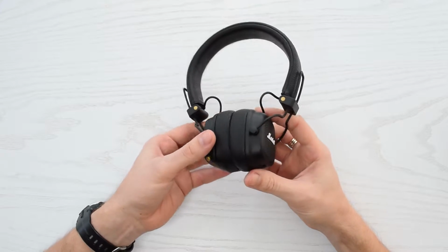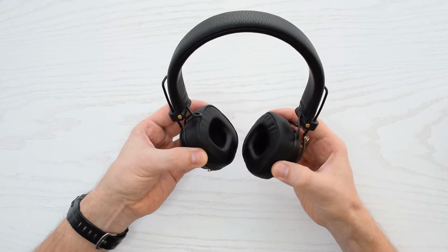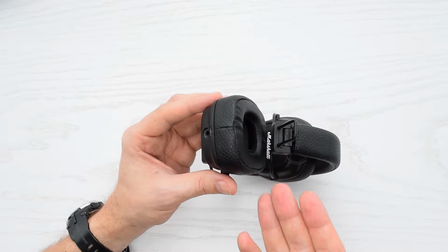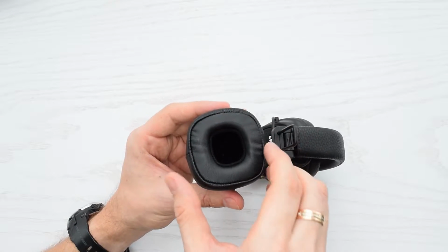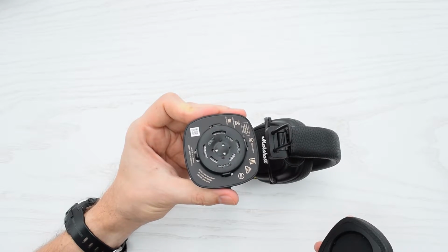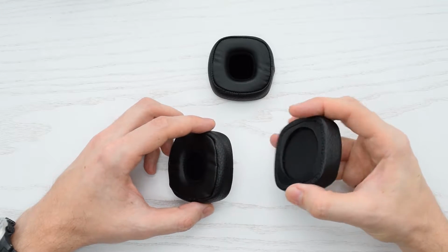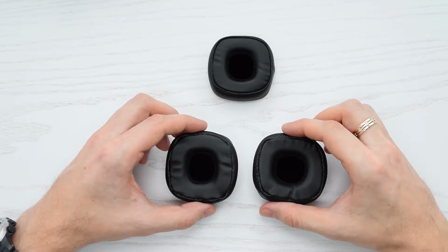I've been using these headphones for about 6 months, and as you can see they're in absolutely perfect condition. So to remove the earpad, simply hold the ear cup like this, then turn the earpad counterclockwise and pull it off, just like so. These earpads cost about $7 with free shipping. I'll put the links in the description.